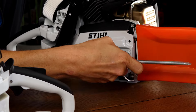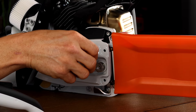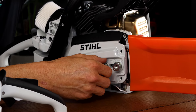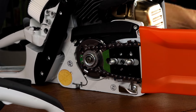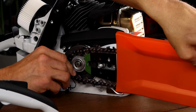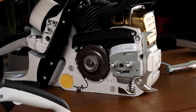Taking off the sprocket covers — the 362 is available with the M-Tronic computer carb or without it with a traditional style carburetor. Initially when that system came out there may have been a bug or two that scared people, but for the last six or seven years that technology has been selling on a lot of saws without a single hiccup. It does make it really peppy and I'd say it's a good feature to have, but if you're a traditionalist who wants an old-school style carburetor with a choke, that's still an option.